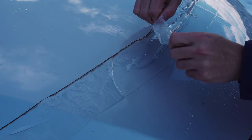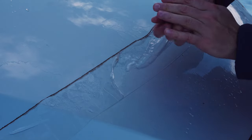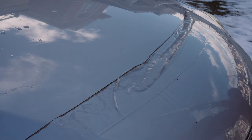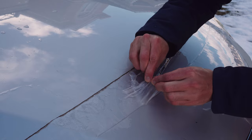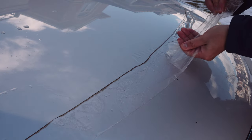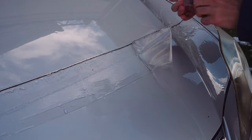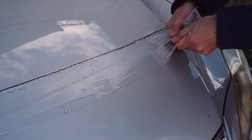All this remaining stuff is just the glue — the adhesive that made the paint protection film stick. It's getting hard again so I'm going to get more hot water. With more hot water on there, right away it feels like it's coming off way easier — that's why I highly recommend using hot water, especially in cold weather. Look how easy it is with a little hot water. It's kind of satisfying peeling it off, and you can see this line of dirt and gunk that has developed over time on the paint protection film.